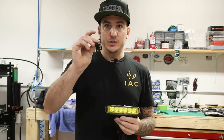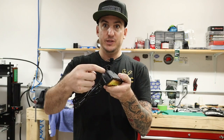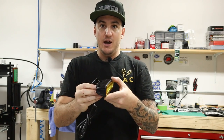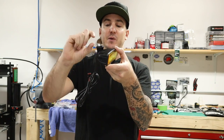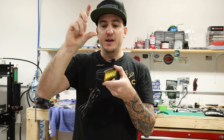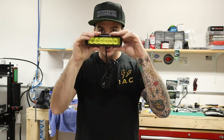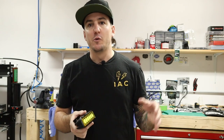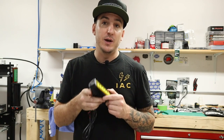In addition to that, there's a little bracket that comes with this, and basically that's going to go on here. You're going to use the cap head screws on either side, and then you've got this bracket that can pivot around. What we're going to do is set this up so that this bracket is on the top, and we're going to use the headlight mount bolt that runs up through the bottom of the lower triple tree to mount the headlight on top. We're going to put this in under the triple tree, and this is going to sandwich real close right under that triple tree. That particular setup will work on a 49mm front end, so whatever bike you've got that has that, this will work really well that way.